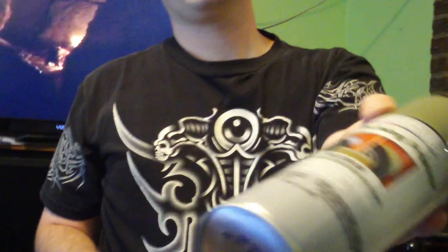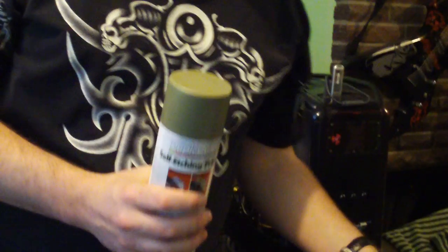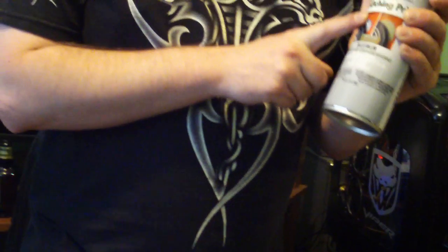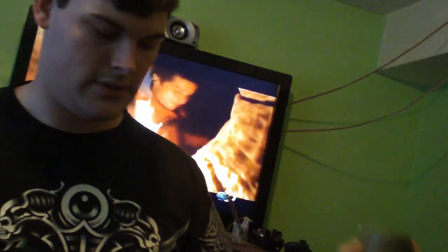I have good old etching primer, and I have standard primer as well. I got the cheap stuff since the automotive store didn't have it, it was like $3. This is $4.99. This all together would probably total $50 to $70 roughly, I'm thinking. I'm getting etching primer, and I read up on it, and apparently it's a chemical that forces itself to attach to the metal better, so that's why I got that. The reason why I got the cheap primer is because some of the pieces, such as this, which is the top with the 240mm fans, is plastic, and I'm not sure if the etching primer will eat through the plastic, so I'm doing a better safe than sorry route.